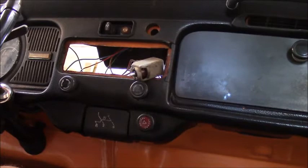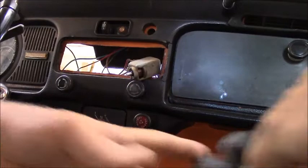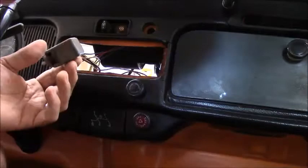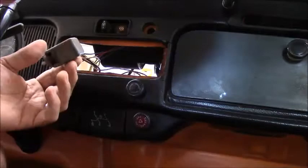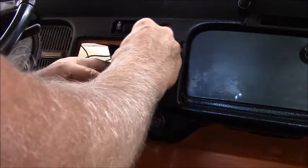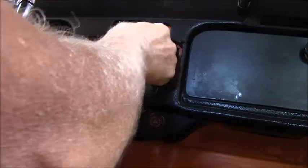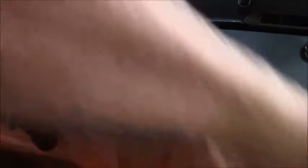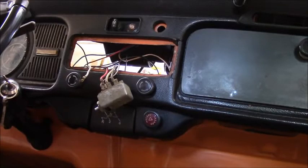Very scientific setup here — I actually got my parking brake fixed and readjusted too. There's a gray wire hanging out here with a piece of heat shrink on it. Everything seems to be over the top, so I'm going to shove it back through, get it untwisted, and reroute these wires a little better. I've dropped my piece of heat shrink inside somewhere so I'm going to have to cut another one. I've got an electric heat shrinking gun — I really hate to see people do heat shrink with a lighter.